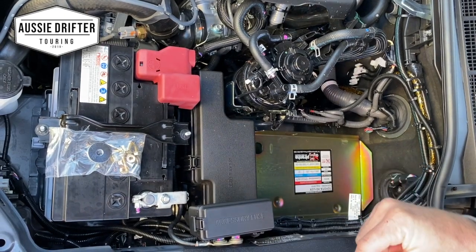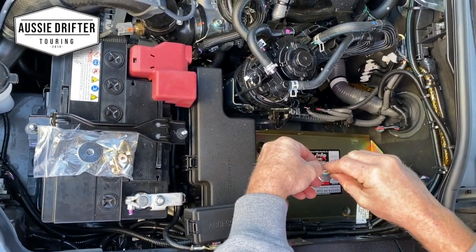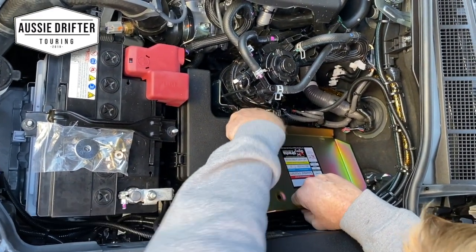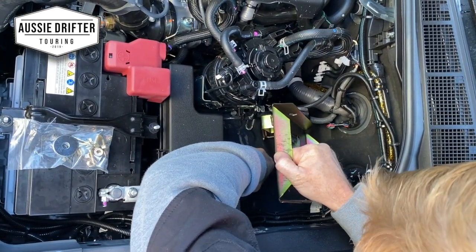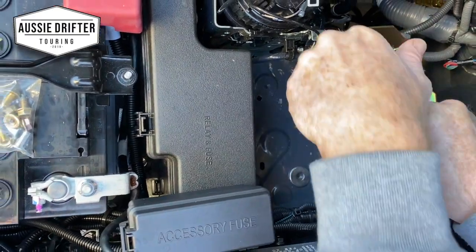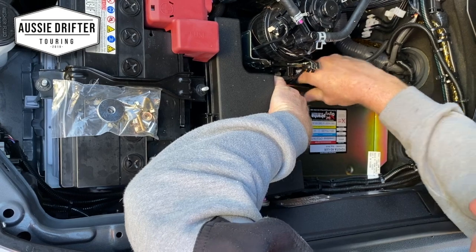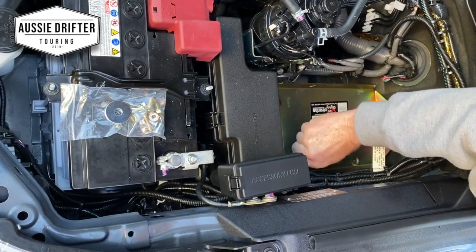That thicker one is what they're referring to as the spacer washer. It's designed to go under our front mudguard side mount — this one here. That's going to space our tray up and we're going to go straight into the Toyota thread in the mudguard. So we'll lift the tray. You might be able to see that bolt there now — that thread in the mudguard. We place that over the thread and carefully sit our tray back down into position. We can just do this one up finger tight for now, so that'll just hold the location.